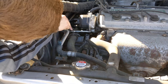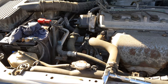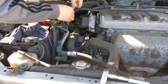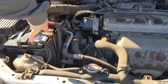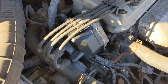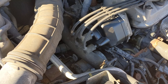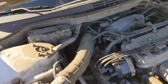Don't over torque it. That should be good. Go ahead and plug the connector in back here. Now I have to look at my reference photo so I can see how the spark plug cables connect. I believe it's pretty simple because they all just fall into place, but I'm going to check that now and be right back. I went ahead and connected up all of the cables running to the distributor. They all just run over and kind of just fall into place. I would suggest taking a picture yourself so you know where everything is. I'm going to go ahead and start the vehicle and make sure everything is running okay.